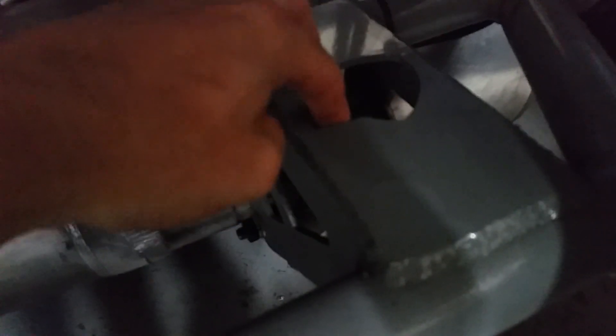They do all their own bracketry — this piece was water jetted, then welded in. This is a cage. The motor is over there on the left, and over here is the controller and inverter. The differential is attached right from the middle. It's one gear — a one-gear transmission — and then there's your half shaft here. The axle itself and the CV joint are factory M3, factory BMW. We adapted the flange: we welded the M3 flange onto the spline part that goes into the differential. So it's kind of a hybrid solution.